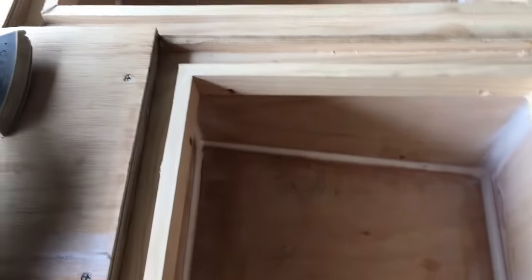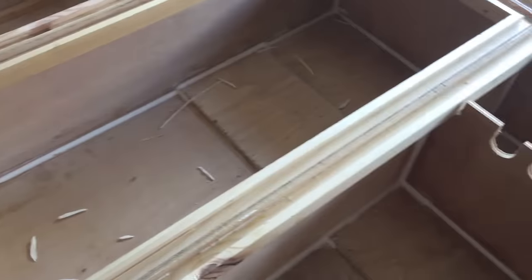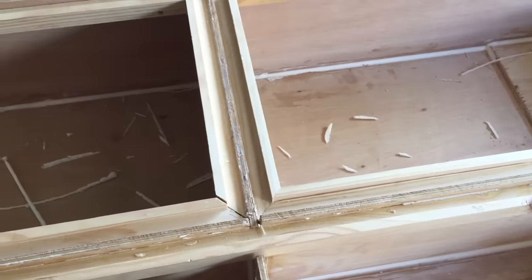So I've done the first three hatches. Now I've got to go through and tidy up everything else. Fun day in the office. I'm going to keep going. Right, all the glue is removed. We still have to vacuum it out, but we've got all the glue out from underneath all the ledges and from all the corners. So we're ready to start epoxying on the inside.